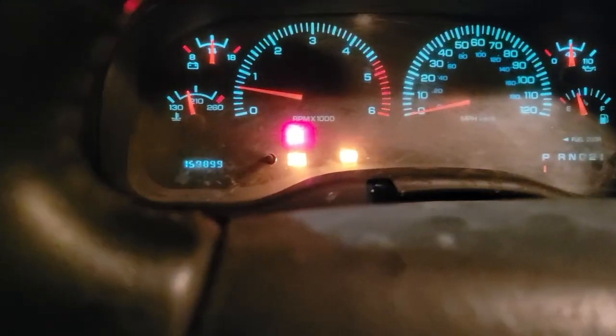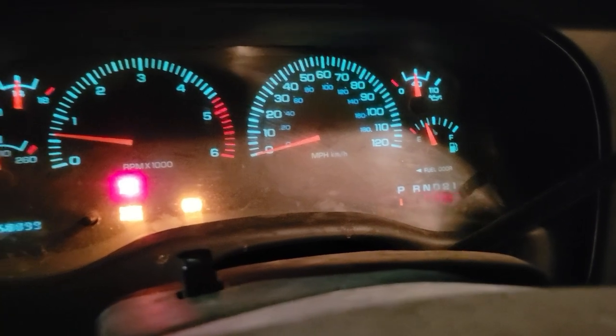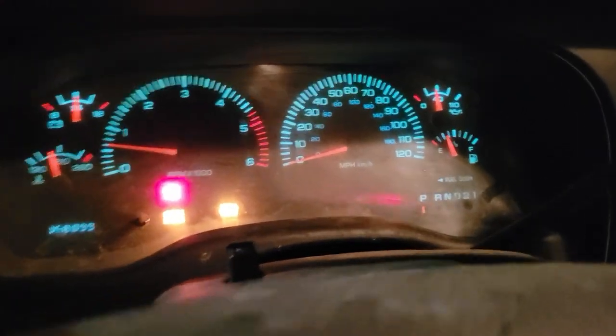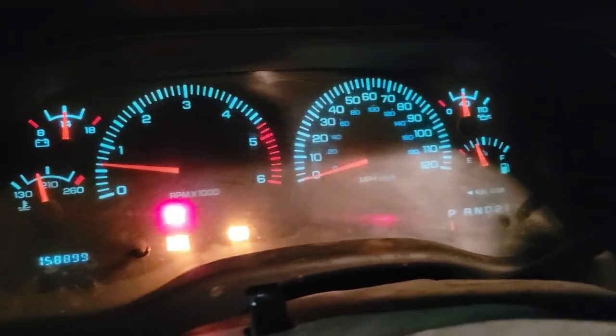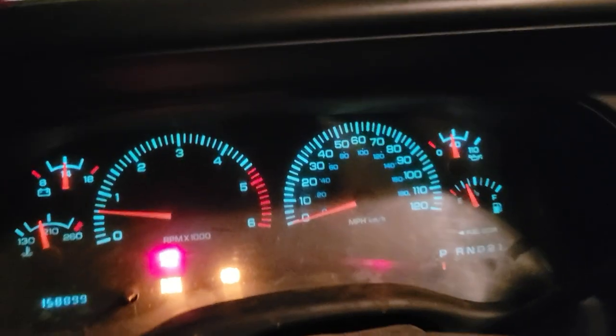I thought the muffler was bad too. It's not. It was all that passenger side manifold was leaking, and mostly that flange with the busted off bolts. Now, hopefully the driver's side hangs in there for a while. That would be really cool. But you never know. So that's freaking sweet.